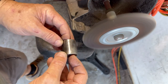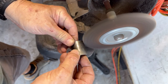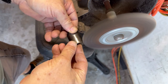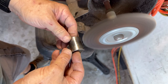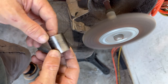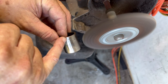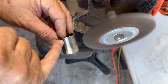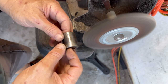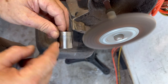All right. See, this half is going to be easy because that's always inside. This, depending on the wear on the pads, is out further, out in the elements. This is in brake fluid. So I'm going to clean this side off first, get it all good, and then concentrate on painting that.